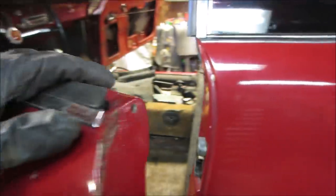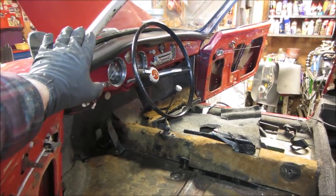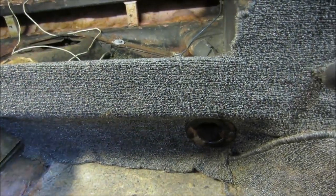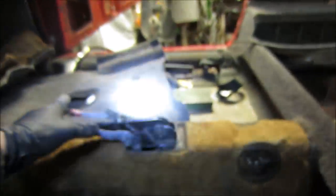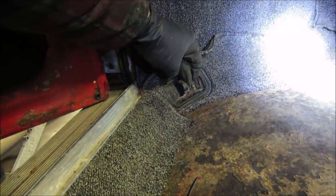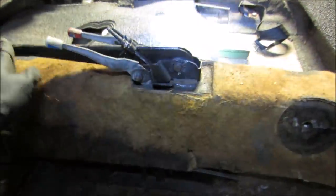The defrosters were probably the worst because of the distance they have to travel — up around, through the vents — and by the time it gets there you barely get a trickle of heat to help defrost the windows. But where it's decent is right here: this will heat the car fairly well because it's only about a foot or two away from the heater boxes. If you hook this one up you can turn the heat on and off. The heater channels have a vent that slides forward and back to allow heat by your feet, but they tend to rust in place after the car is about 2 or 3 years old. So now I'm going to get the welder fired up and go fix that.